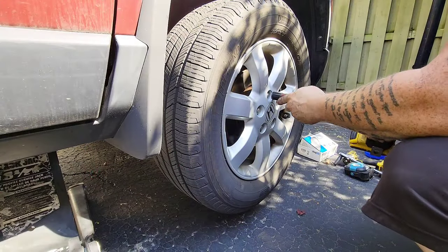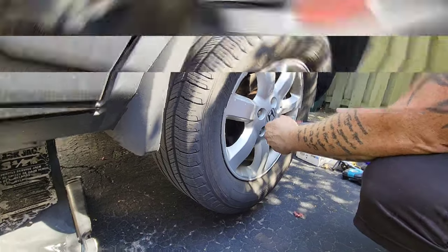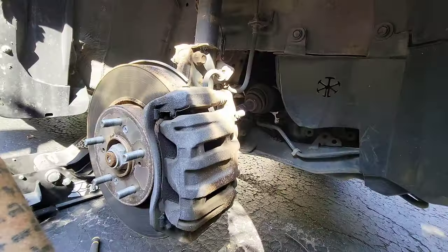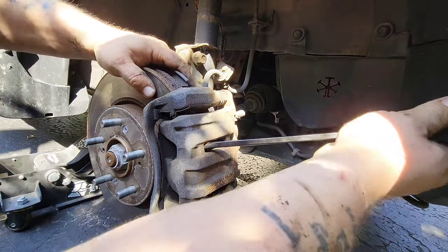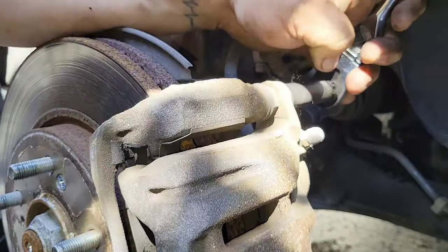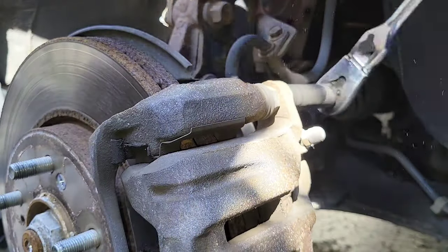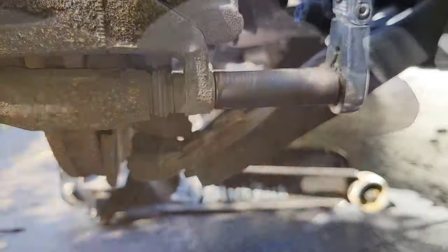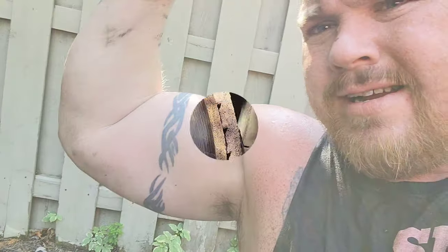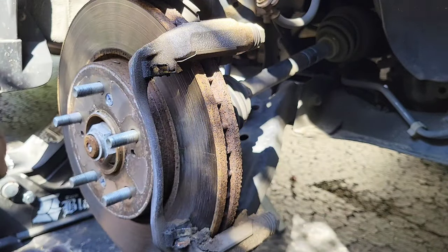Let's rip these off here. Give it a little kick. There you go, just like so. Let's put a screwdriver in here and compress the piston a little bit — that way once we take these bad boys off, it's not stuck on there. Give it a karate chop. There we go — it needed a big karate chop. Get on the bottom one like so and give it a karate chop. Look at that. Let's go ahead and remove these pads. We've got our nifty little gadget here — you can do this one-handed. Set it down just like so, do a little pump action. I already got them flat now. I like that little tool.